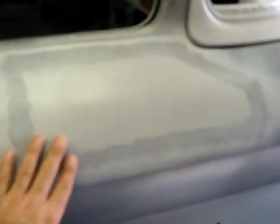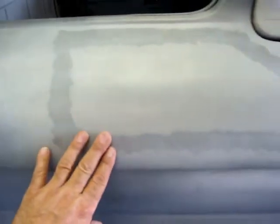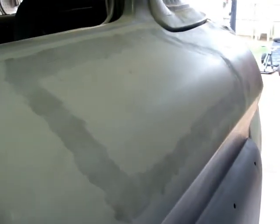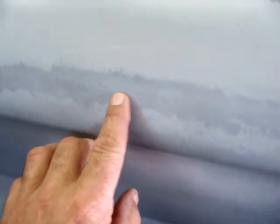This was messed up pretty bad right here, where I had a mirror that went from here up to here — it was dented in real bad. So I went ahead and cut it out, found another door in the junkyard, cut that piece out, and welded that in. That was my first weld job right there. I've got a few little pin holes here I've got to fill in — stuck a light back there. There's a pin hole here, here, and here, so I've got to do a little more surgery on that.